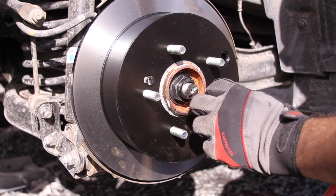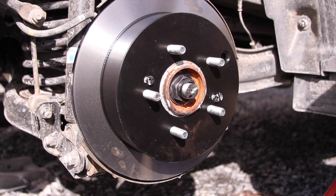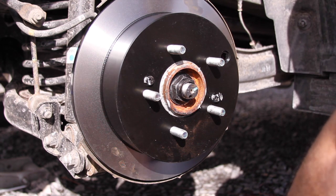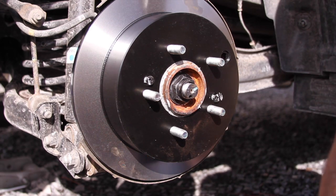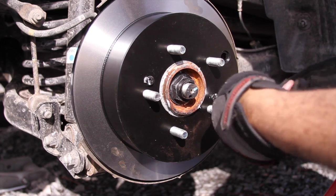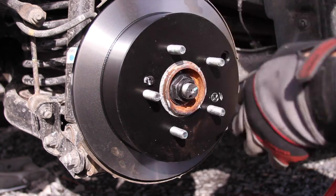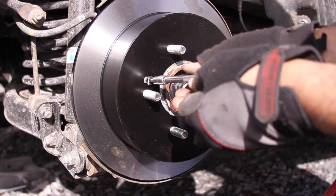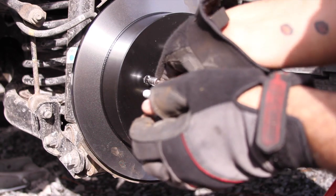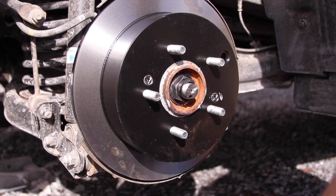That's up to you. Alright, let me clean the anti-seize off my hands, because anti-seize gets on everything, and screw them in. I like these. I had the customer get these rotors because the non-mating surfaces with the pads are painted black, so it's less likely to get rusty. So it'll look good, you know. Once your car's looking good, right?